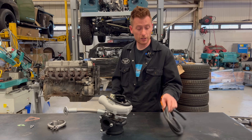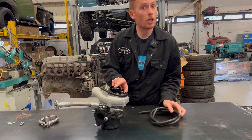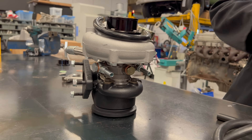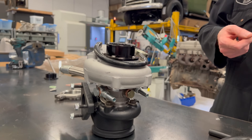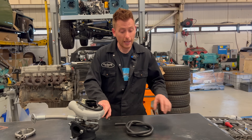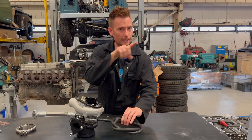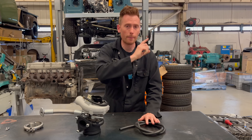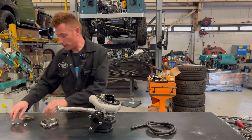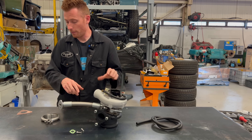The other things that come with the turbo include a length of water cooling hose — because if you're running this in a W210, you're going to put the original coolant return line that went from the front of the radiator to the top of the header tank directly into the barb of the turbo, and this will then go to the header tank. So you'll basically have enough hose to be able to route that passage back. A couple of other bits next to me here: the gasket and bolts will obviously come with the hybrid — you'll get everything that you need to fit it.